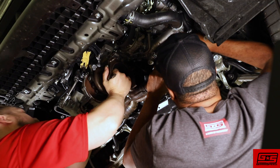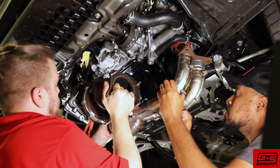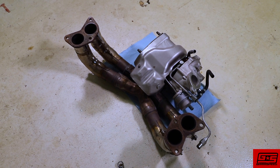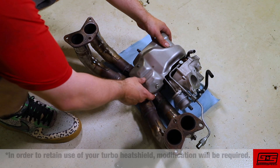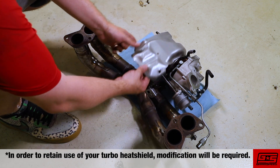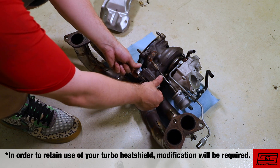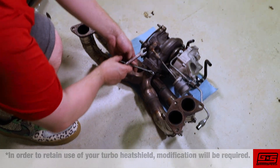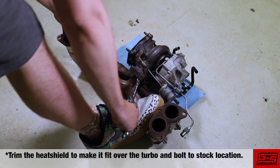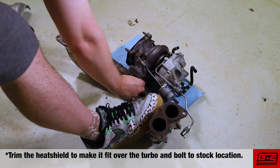It's been a lot of work to get to this point, but with these bolts removed you should be able to lower the header turbo assembly down to the ground. With the header assembly on the ground, remove the heat shield and the heat shield bracket. This should now give you access to the other two header bolts. Using your foot to keep the header in place, or if you have a vise handy, loosen the two bolts on the top of the header.